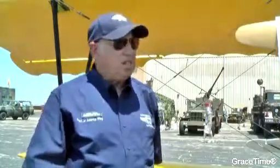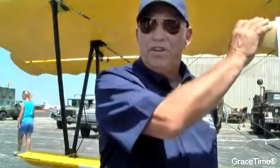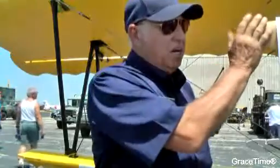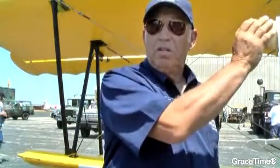It's got a 2180 Volkswagen high performance engine. It's built for airplanes, cam, crank, everything is built for an airplane. What kind of horsepower does it put out? About 115 horse, and that's almost a constant horsepower. And with a redrive system on it, it makes a really nice combination. Redrive? I don't even know what that is. The redrive is a built-in reduction so that your engine can turn up to 3,200 RPMs for more power, and then you can bring the propeller down in RPMs so it becomes more efficient. It's a gear reduction, more or less. That's correct, and it gives you a little more power.